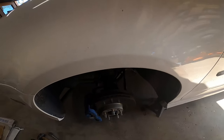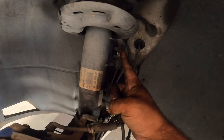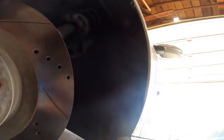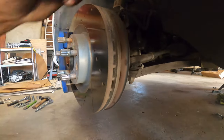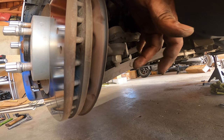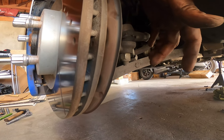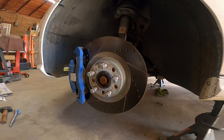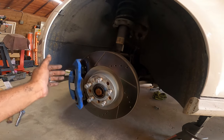On this side, you're going to need to remove the 18 millimeter bolt right here, and you're going to need your 14 triple square right here — this is what's holding the strut in place. Then going down below, you'll see three 16 millimeter bolts for the ball joint that you need to unbolt. There's also an 18 millimeter right here on the tie rod. I typically don't recommend removing the tie rod, but this time I do because the caliper and brake system on this car is immensely heavy and you need to be able to move this left and right.